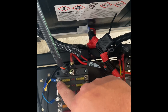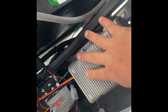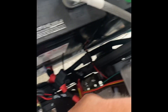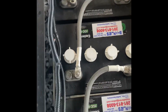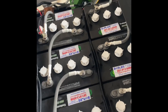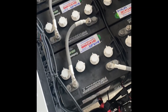Then I just plug in all my 12 volt accessories. We're running a 400 watt amp tied in right here - it has an activation wire tied in here and a constant power wire. So whenever you turn the run/tow switch on and you turn your key on, this turns on your reducer. Whenever you turn your key off, it kills power to all this so you don't have to worry about discharging your batteries. It's always better to only plug into your main positive and your main negative. Jumping across packs is not a good idea - you can do it, but in the long run you're going to end up zapping two batteries and cause other problems down the road.